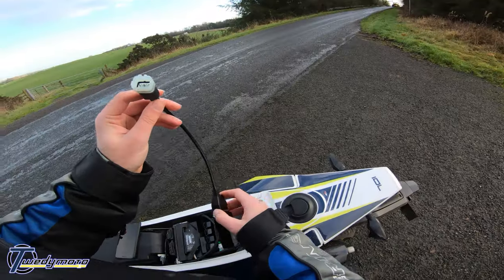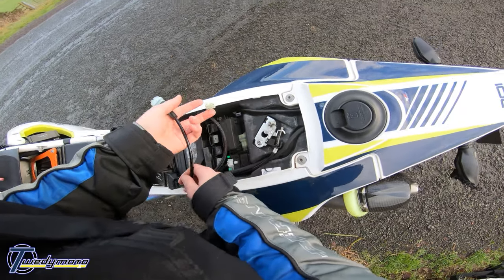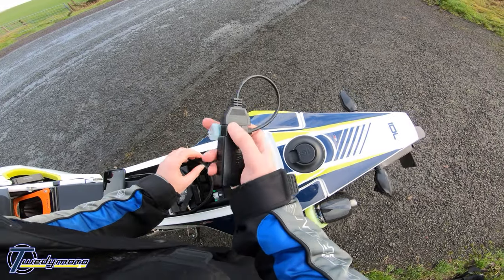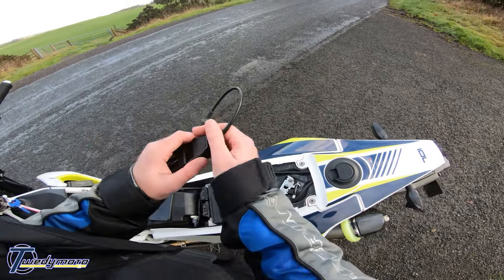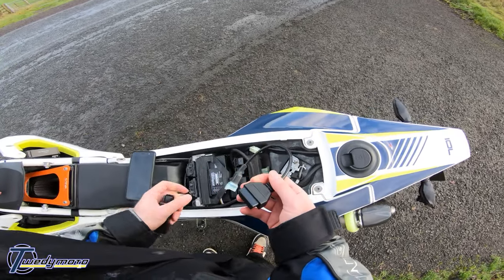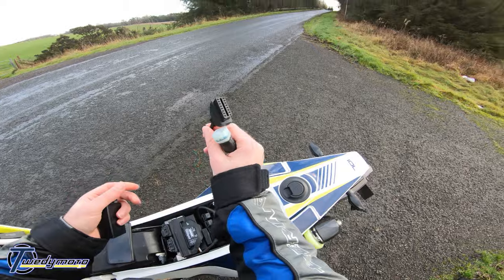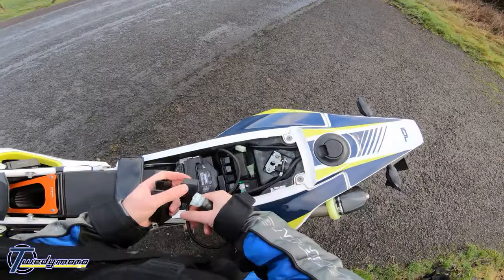This cable is a 4-pin cable. Those four there. On the 2016 bike, and for the KTM 690s, it's a 3-pin cable, so it is slightly different. On the website that I got this cable off, it said for KTM Bosch ECUs, but this is actually a Keihin, whatever you want to call it. So you need said cable, which converts just to a normal OBD2, same as cars, vans, and so on.